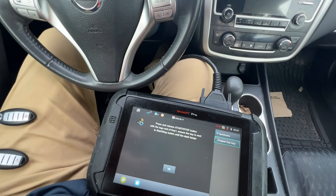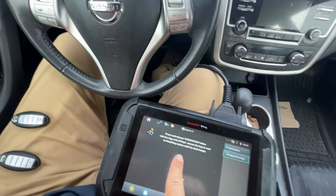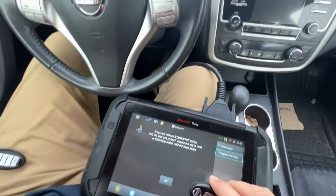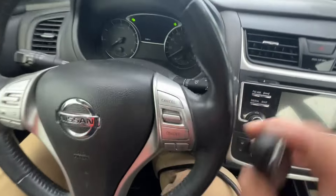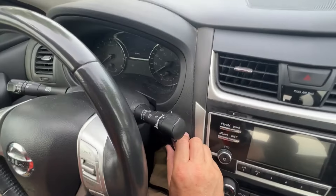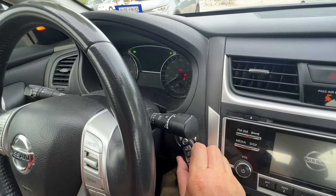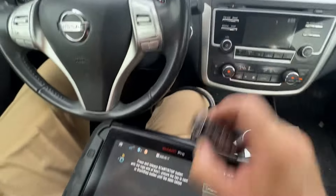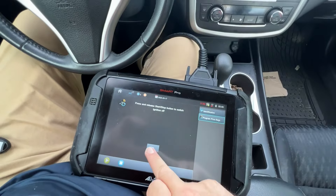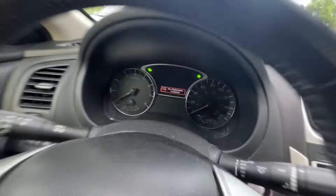You want to program more keys? No. Now I have to use key one — this is where people make a mistake. If they mix them up, they grab the wrong one — they look pretty similar, just a warning. Key one. Now listen, it's not going to flash — it's going to make that audible beep noise. One, two. And turn off. And we're done. It says on the dash: complete.